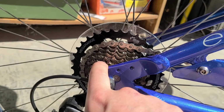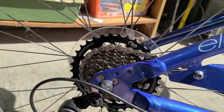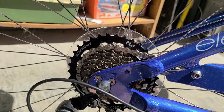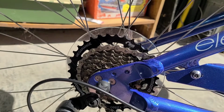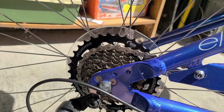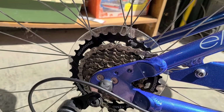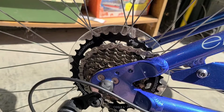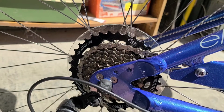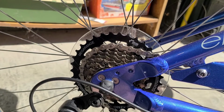Now, if in one revolution your propeller is traveling further, that's similar to being in this gear here, where your legs aren't really turning as fast, you're not doing as many revolutions, but it's a lot harder to push and to pedal. So when your boat is overpropped, your motor's RPMs drop down, and you're asking your motor for each one of its cycles in the combustion cycle to do more work.